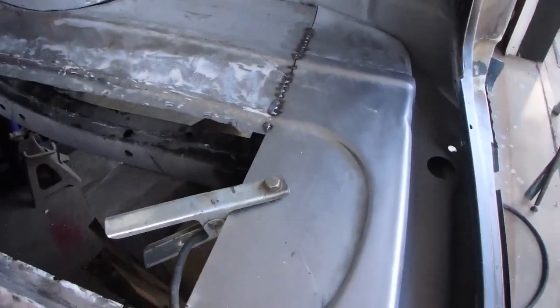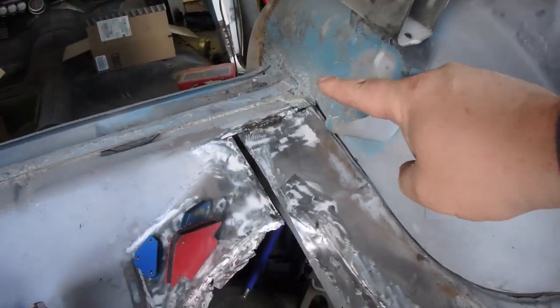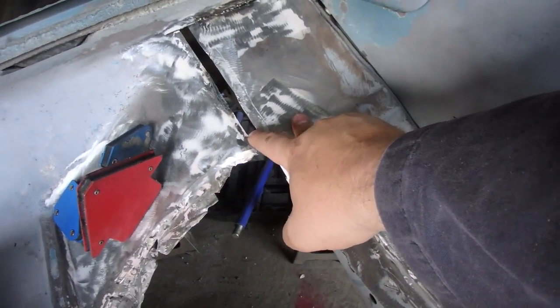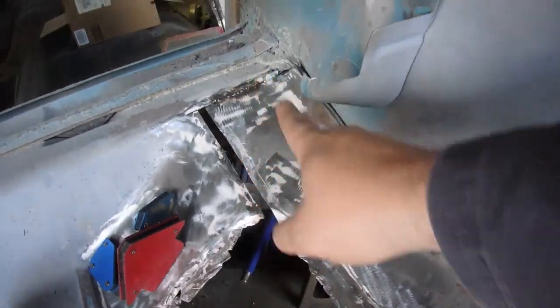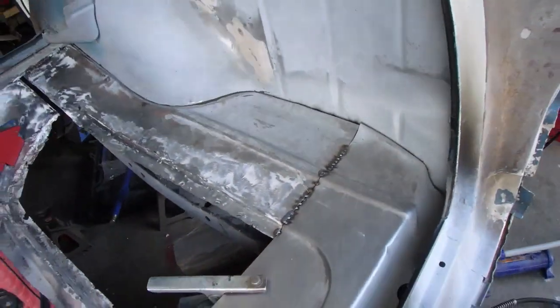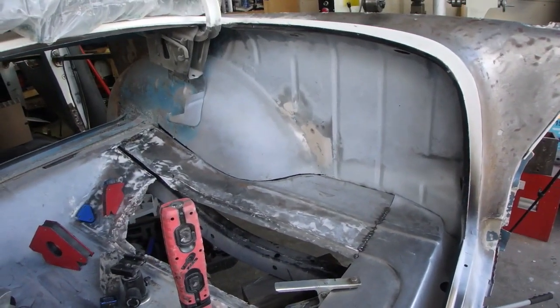I think that's going to be enough for today. I spent a few hours trying to get the back piece of the trunk jacked up, tacked into place, and get everything fit up — it's kind of a nightmare. I didn't catch that on camera because I was too busy trying to get that done. But we're tacked into place here. When we come back out tomorrow, we're going to finish this off — cut the piece of metal to fit in between there, finish welding it, grind it smooth, and then that section will be done.